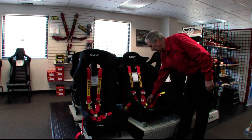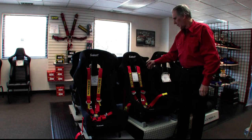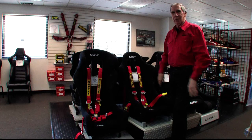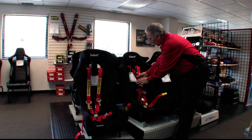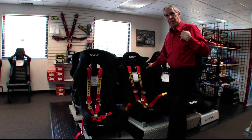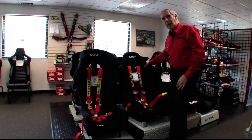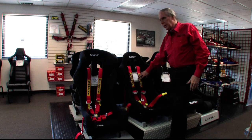These belts come with a two-inch lap belt in pull-down configuration, and also an additional lap belt in pull-up configuration. They've also attached Velcro patches on both sides of the shoulder belt so you can attach the loose end of the belt to the Velcro — every time you stand on the brakes, you're not looking at loose belt ends floating around. They've also put their logo on a vinyl-type material on the backside of the belt to be more comfortable, and it fits better on your head and neck restraint, providing the right amount of friction against the yoke. There's also a piece of material on the belt edge designed to route your communications wires and drink system tube along it, so they're not flopping around inside the race car.